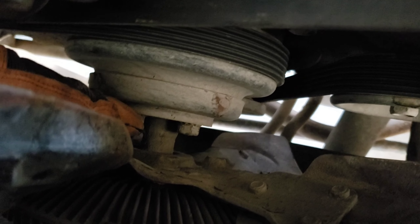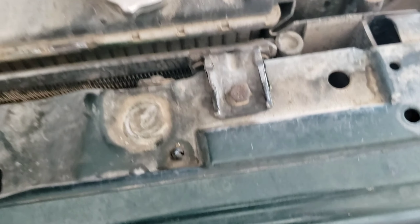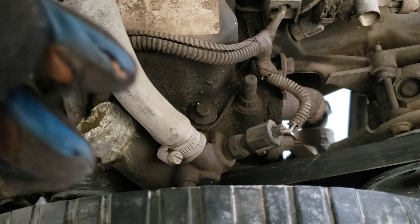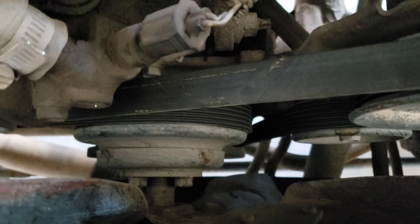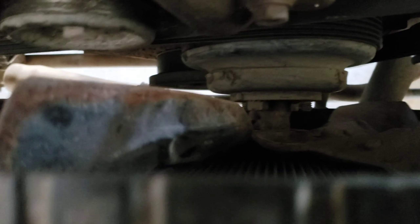Next, you'll want to take off these four bolts around the post of the fan clutch. They are half-inch bolts. You'll need a wrench — six-sided is best. A little tidbit: this fan, because of how it's balanced, you can see some of these blades have a much bigger gap between them. Use that to your advantage — you have a lot more room to get in there if you use that big gap. I already got a couple of bolts off before I realized that. You can see there's a bigger gap there, but these are closer. That's just how this fan is balanced; it's supposed to be like that. Go ahead and get those bolts off.